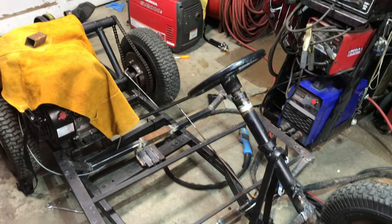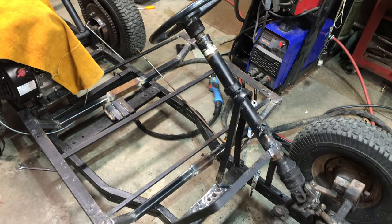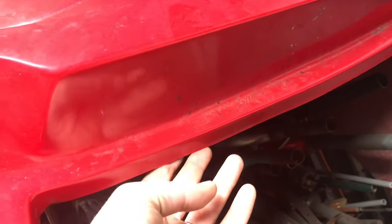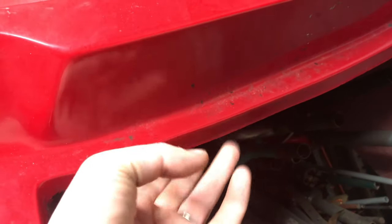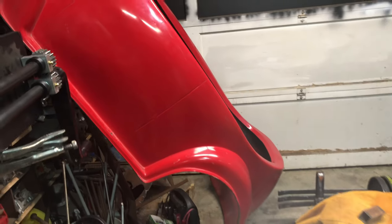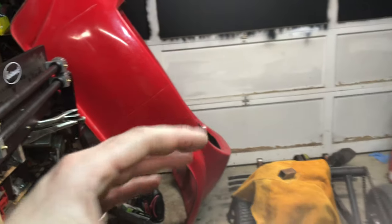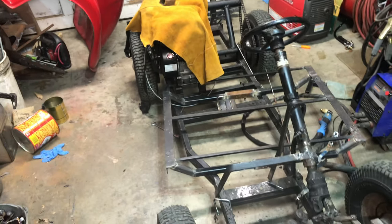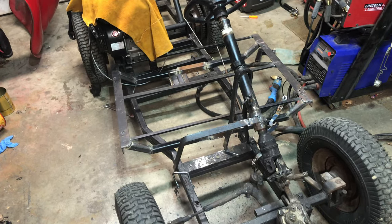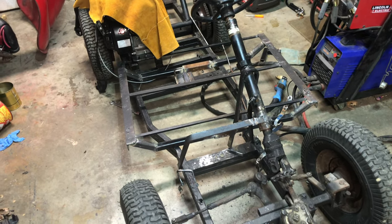Get the steering all tightened back up. I need to notch on the Beetle frame itself right here — I need to kind of notch a little arch where the steering is so that the car body won't keep banging there, because it's just fiberglass and I don't want to bang a hole in it. Fiberglass, when you have repeated stress kind of banging on it, will eventually crack and break. So we want to make a notch so that doesn't happen.